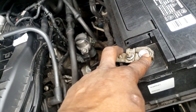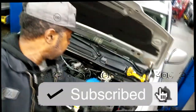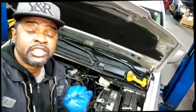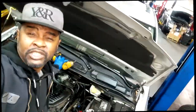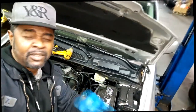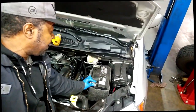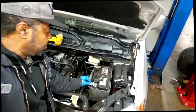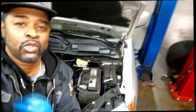Let me play a clip of that video. Minivan owners — or any car that utilizes battery terminals like this — be extremely careful. You should not be using an impact or electric drill on these battery terminals because you cannot replace them independently. You'd have to get a complete engine wiring harness. With this terminal all the way on and tightened, the battery connection is still loose — that's not good. You'll get all kinds of battery fault codes and alternator codes.